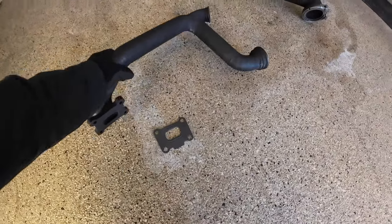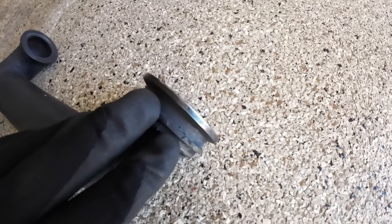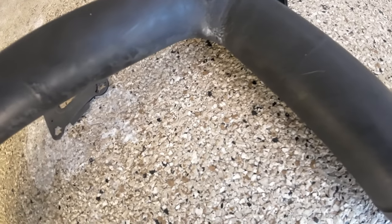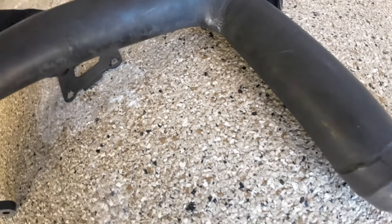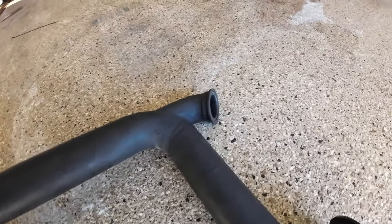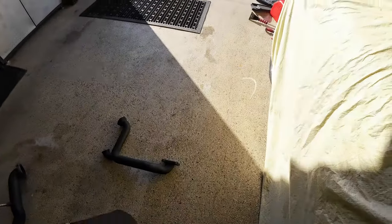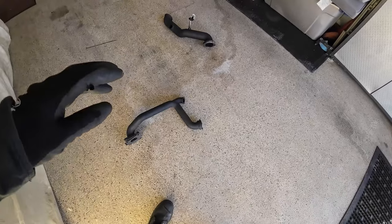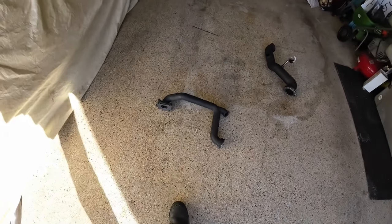Gasket, and this right here is the manifold. So the wastegate is going to be right here, and then turbo right there. So let's see what we can do. I'm gonna throw on the gasket and then try to PIT maneuver this thing into place without moving anything yet. And if I gotta push down a bunch of stuff, I will. And then I'll work around this instead of trying to work this around everything else, which is pretty impossible. So that's the plan.